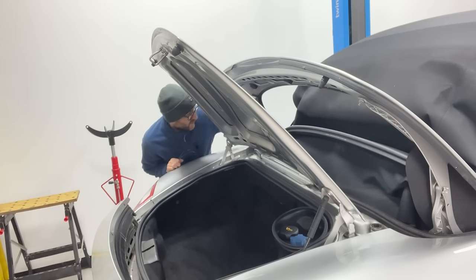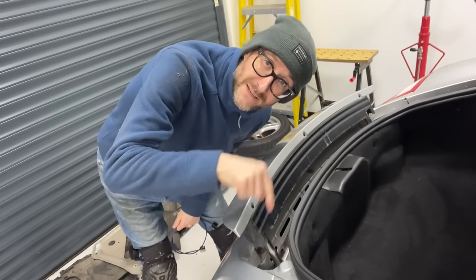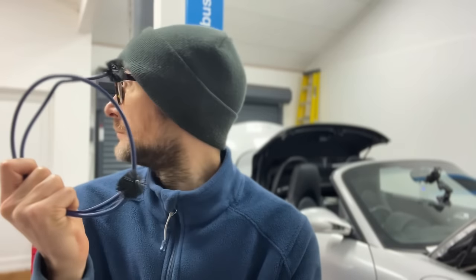There are another four drain holes here with the roof up and two with the rear spoiler lifted. What Mr. Stingray suggested was I get one of these — it's a trombone cleaner. You basically insert this down the hole and it pushes all the debris and rubbish out. It's clever, isn't it? So if that works I'll be happy and if it doesn't, I'll be very sad.